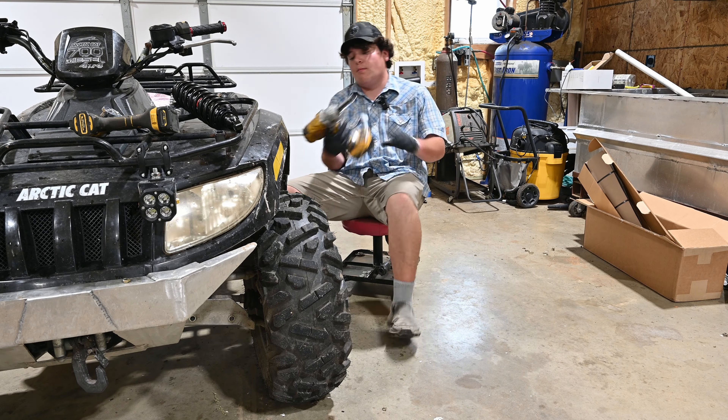I've got aftermarket wheels and tires and they're kind of deep dish — the nuts go way into the wheel. You'll need a 10mm at the bottom. Be really careful with this — it's not a very strong bolt when you're tightening it. Don't use power tools, do it by hand.